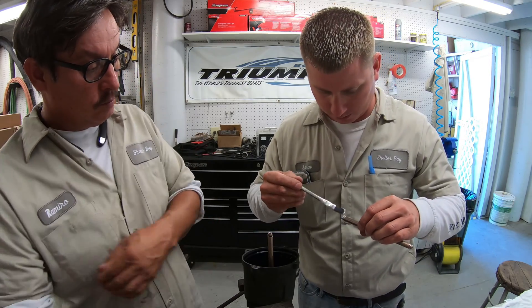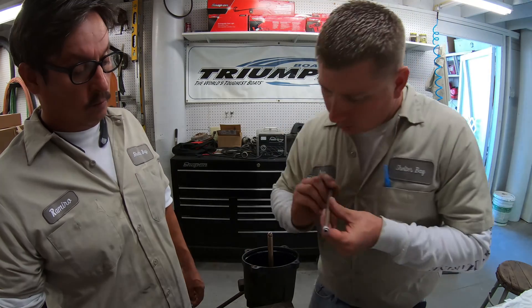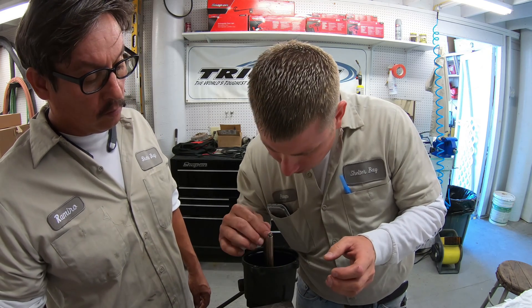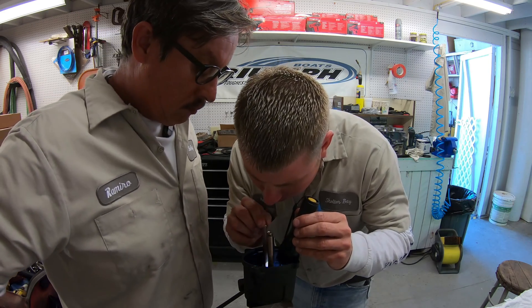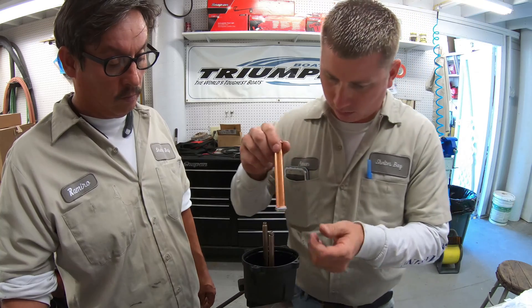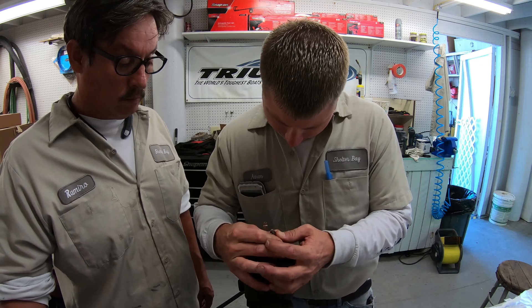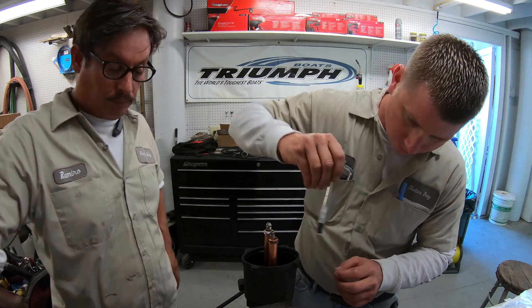I've tried oil and other greases which didn't go as smoothly, so I recommend using this stuff. Install an o-ring onto the end of the inner tube, then lightly lube it up with the molly lube. Insert it into the housing and as you press down, spin the tube so that you can feel it seat properly. Spin it after it is seated to make sure the o-ring didn't roll over. Then add the other inner tube into the housing the exact same way, and put the outer tubes in that same way as well. Then grease up the o-rings on the top of the tubes.